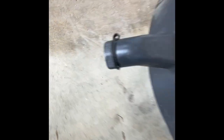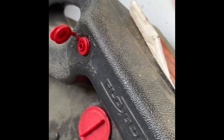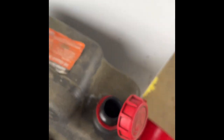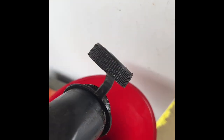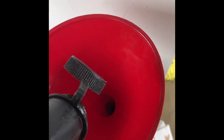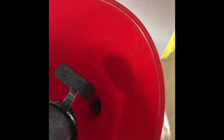The last thing we'll do is slowly remove this cap, use our funnel, open this valve, and slowly pour the oil into the old oil tank to recycle it. Valve's open — draining the drain pan into the old oil tank.